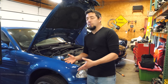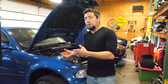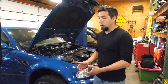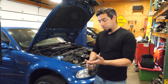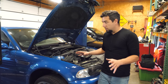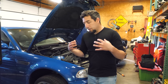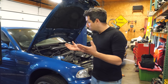When you talk about E46 M3s, there are three big things — called the big three — that need to be done to these cars at some point or another. The first one is chassis reinforcement, and this car has been reinforced, which was huge for me because it's a lot of labor. The next two things are Vanos upgrade or rebuild and rod bearings. I have no history on this car whatsoever, so I might be doing a job that doesn't need to be done. However, my own peace of mind is worth it. I want to know the rod bearings are good, so I'm going to replace them. And that's what we're going to do today.